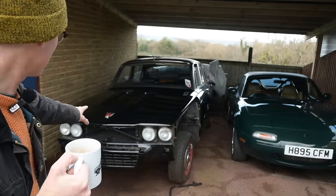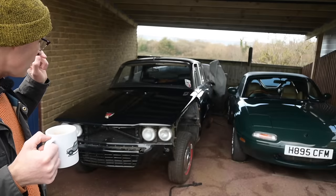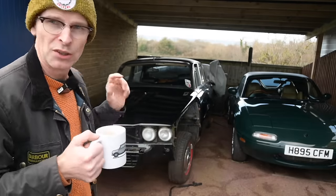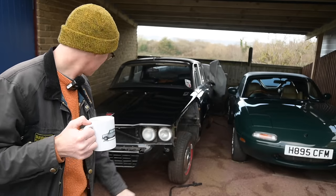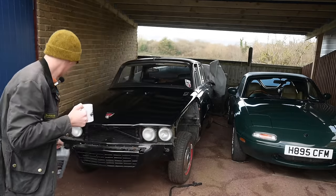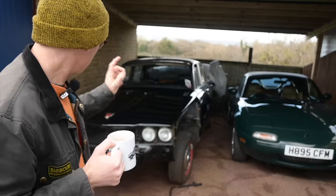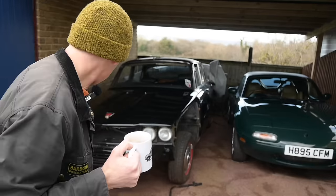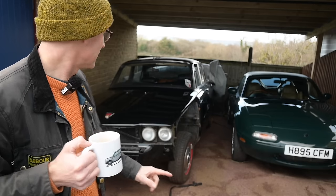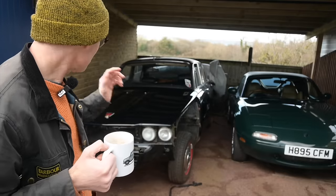This video is about making this thing drivable. In the last video, I was convinced the gearbox wasn't selecting the right gears in the right place on the selector. Looked underneath the car, that seems to be working correctly. So I have acquired some ATF, so I'm going to drain the contents of the gearbox. It actually takes 8 litres of ATF in that thing, which is a lot. That's only a gallon of 5 litres. However, the torque converter is going to contain a lot of fluid, so I think 5 litres will probably be enough, which I hope it is, because it's 25 quid for a gallon of the stuff.